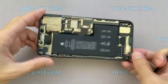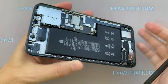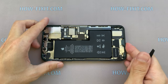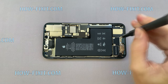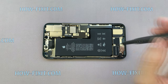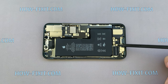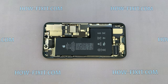To replace the battery in the iPhone 11 Pro Max, you need to remove the three silicone tapes from under the battery. One tape is located near the taptic engine, so let's start by removing the taptic engine from the housing. Remove four screws on the metal panel and remove it. Under the metal panel there is a second battery cable — first turn it off, and then turn off the taptic engine cable.